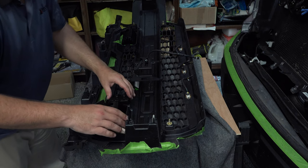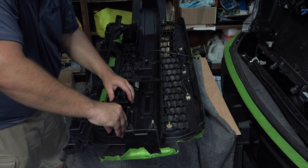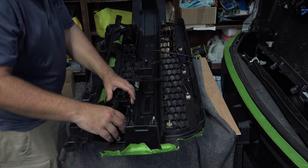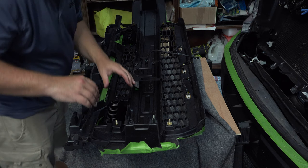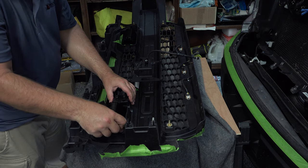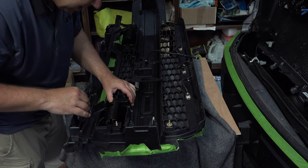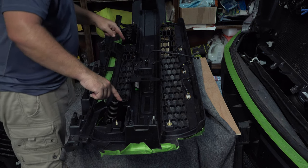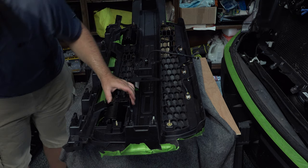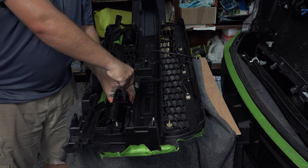At the final steps. But for right now, we've got that flush. Push down on this just like it would be if the top grill was bolted down to it. And kind of get them in the position where you look at them and they're straight. And they should be straight. And as you notice, you remember in the beginning we said we had some play here. I can pull back on this, but it's not going to sit right whenever this is bolted tight. So when you get this in position, you're going to notice that this is spaced the same on both sides. So now we've got it all straight, we can go ahead and tighten down these bolts, because now our adjustment on this angle should be complete.